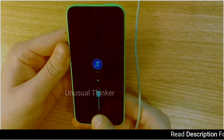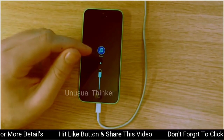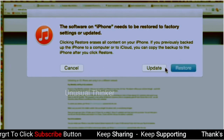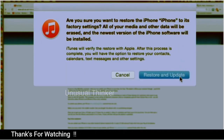Now once that's happened, go over to iTunes which will be flashing at you, and it will ask you if you'd like to reset the software back to factory standards. Go ahead and click restore and it'll ask you if you want to restore and update. Essentially it's a process in which it's going to delete everything from the phone, but the good thing is you'll be able to access the phone even if you didn't know the password previously.